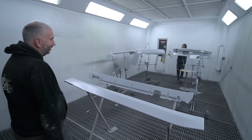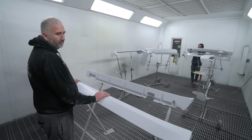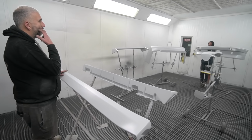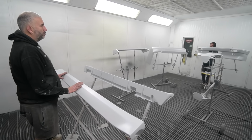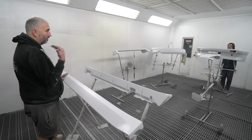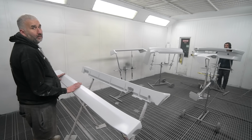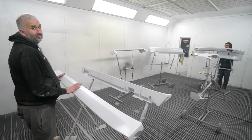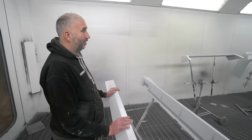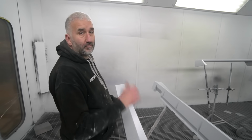Working hard. All right, so, like I said in last week's, we got everything polyestered and now it's all in epoxy. So Steve will start badgering away, getting these blocked 320. And like I say, once everything's 320, then it's a massive wet flat session to get to final paint. So, not much happened this week, apart from a lot of dusty stuff. So yeah, we better crack on. So go on, bugger off.